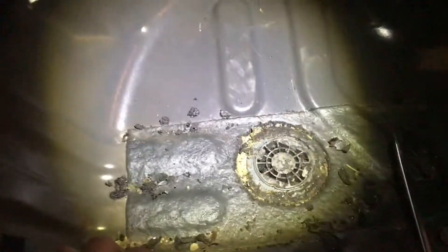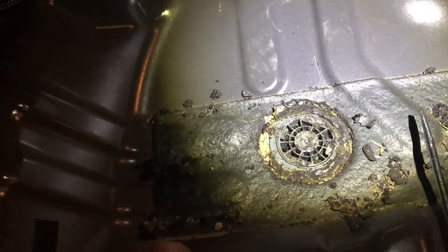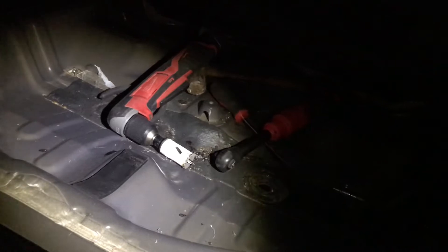Down here is where I'm going to run pretty much most of my wires. There's sound deadening — I'll probably never be able to get that out because they look like they glued it from the factory. So I'm just going to hold all that and deal with it later. I drilled the hole with the hole saw right there, and right where that angle is, that's where my compressor is going to mount. It's low enough, it'll make clearance. On top of that I'll have my tank, mounted on some blocks.